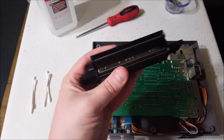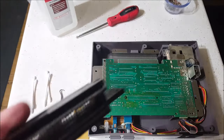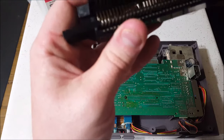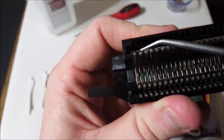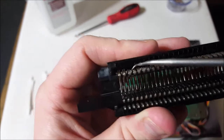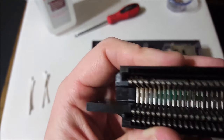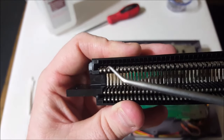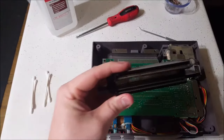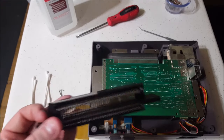Now I'm going to take my pick and do a couple of these on camera so you can see what I'm talking about. Be very careful with these — the pins can come out. Take a safety pin if you don't have the pick set. Get behind these pins and bend them up just a little bit, going all the way down the line. It doesn't take much strength — you're not trying to bend it to touch the roof, just bending it a little bit up. You want to keep it even; you don't want one lower than the other. It takes me about three or four minutes now, but the first time it's going to be a bit of a pain until you get used to the motion and how much strength to put behind it.